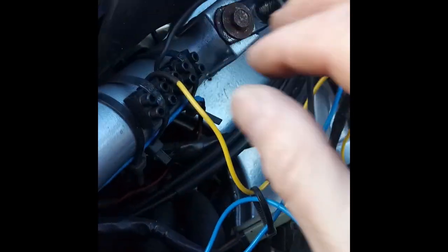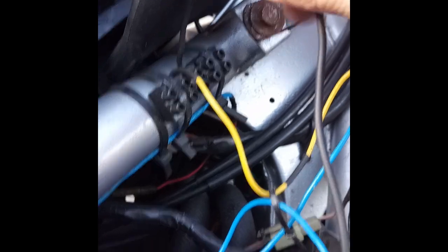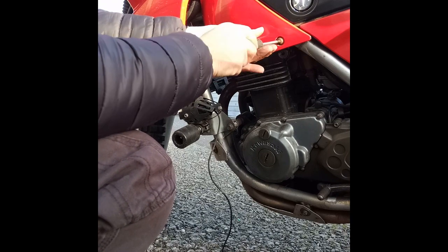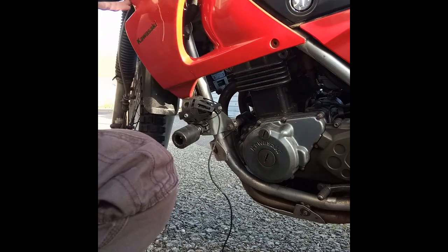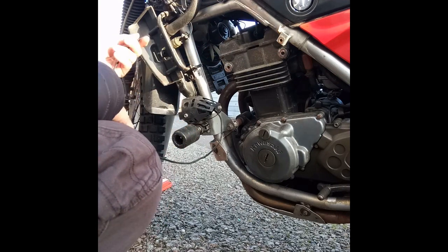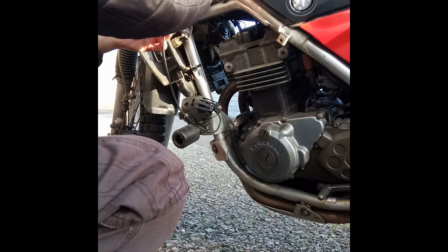I've got one of these plastic connectors. I've fitted my power line to the top one and my earth here. I'm going to take the ends of my spotlights — the LED lights — one for positive, one for negative, and then do the same on the other side. I'm feeding my wire through, across the top of the cylinder head and through to the other side.